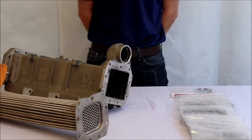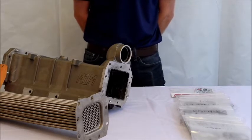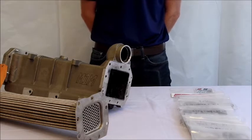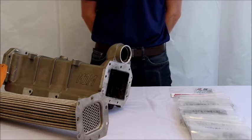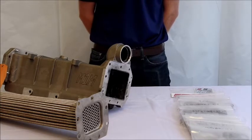Your first step is to dismantle the truck to get access to the engine compartment. This will include removing the doghouse on the truck engine compartment and likely removing the passenger seat to get access to the EGR Cooler.